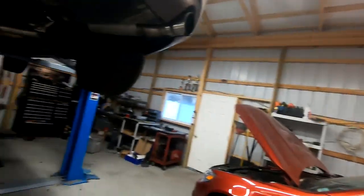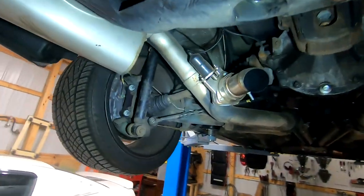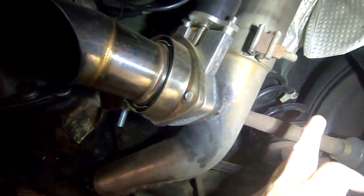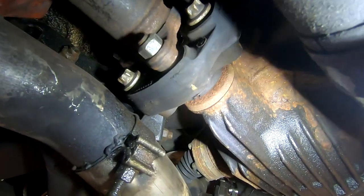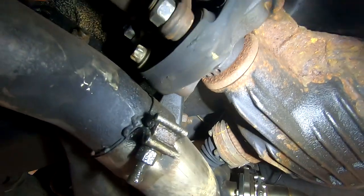I got the GTO up in the air and I did take the liberty of looking at a few things ahead of time. I set up a lighted rig to make it easier for everybody to see. What I came across is there's fluid all over the differential. I checked the axles and the exhaust — nothing's really knocking around. But what I did find is the driveshaft actually has play in it. So the knocking is 100% my differential making the noise.